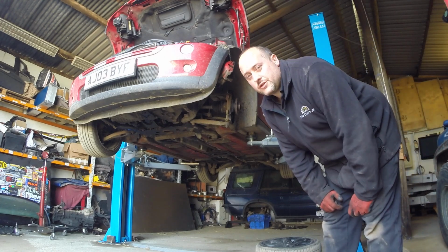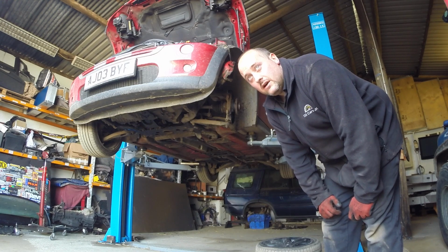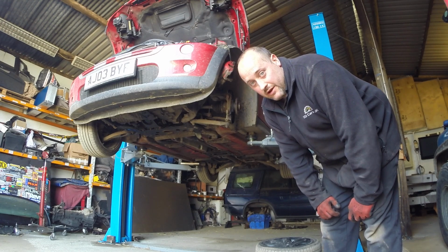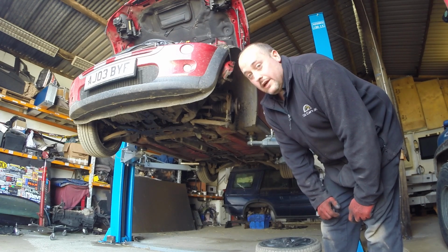Well, unlike the first one, one of them has started to round very slightly, so as opposed to just popping the drive shaft back and getting in there, I'm going to take the hub off of its lower ball joint and steering point so I can get the drive shaft out and actually get a socket straight on it. Joys.